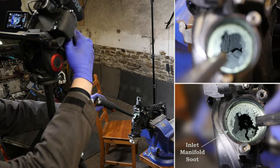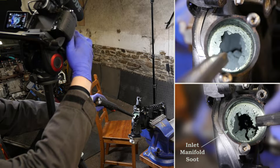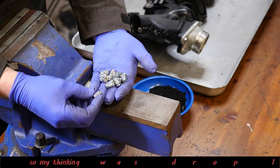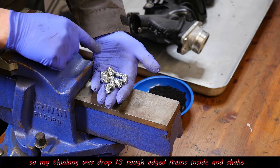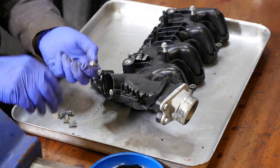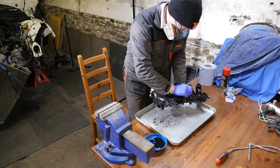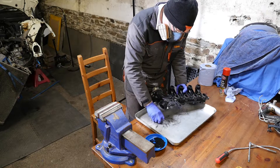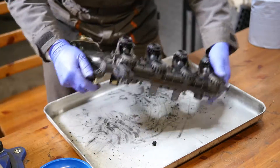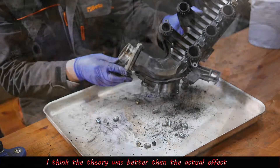This was the pipe connected to the EGR cooler from the previous video, and as you can see there's quite a build-up of carbon inside that which I'd like to get rid of. My thinking was if I put 13 chipboard fixing screws in and shook them around it would knock most of the soot out. It sort of worked, but I have to be honest it wasn't overly effective - I don't think there's enough weight in them to really knock it around as much as it needed.